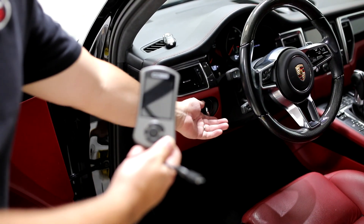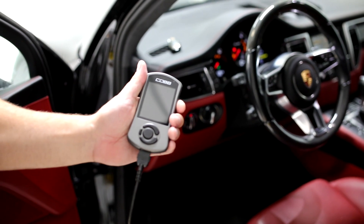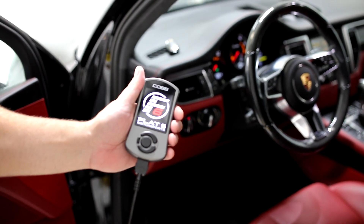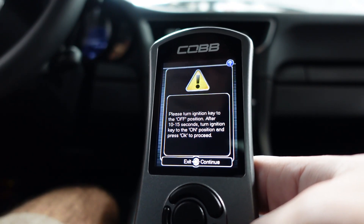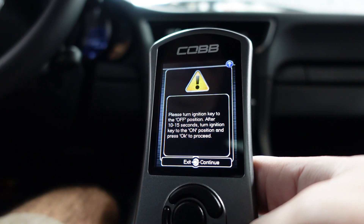The Cobb Access Port takes about 10 minutes to install. You might get some warning lights, the windshield wipers might move, and the fans will kick on — this is all normal. After it's all done, give yourself about 90 seconds before you start the car to make sure Sport and Sport Plus modes come back. What this is doing is rewriting tables on the ECU, changing boost characteristics, fueling characteristics, and timing adjustments — all of which should add up to a good power gain.